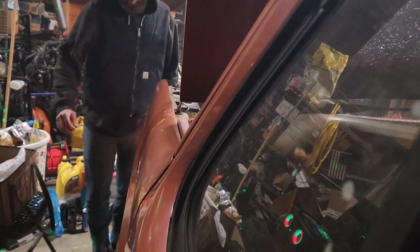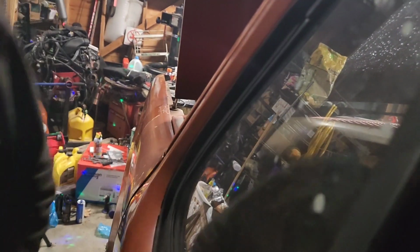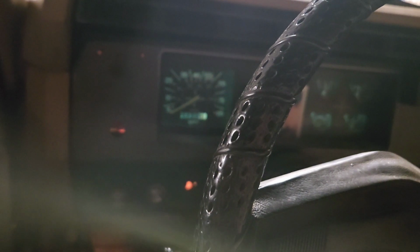But I mean, as you can tell, she wants to go. Let's see if she'll idle. All right, let's see if she idles. No. Too far retarded. No, she don't want to idle. Far retarded. But she starts right up. Alrighty, we're gonna fix that once we get through this 10-minute. We got 10 minutes left.